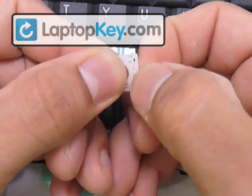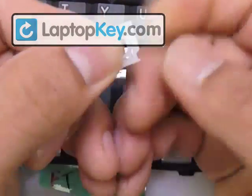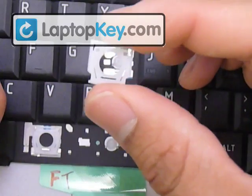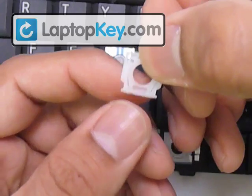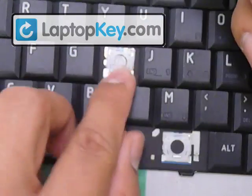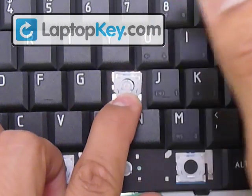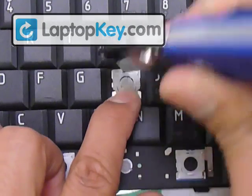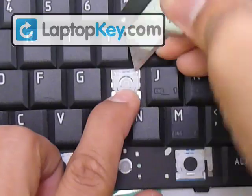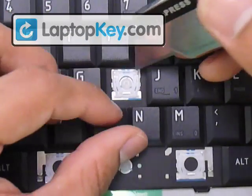There's not enough space for the pin to go into that hole, so hold both pieces tightly and stretch the large one away from the small hinge — that's how you get that pin in there. Now both hinges are one. Put the small bar of the small piece underneath the large hook. Once that's in, hold it down so it doesn't come back out. Stretch the hinges upwards so the metal hooks grab onto them. Use a blade, knife, or anything strong and thin to get those hinges underneath the metal hook.